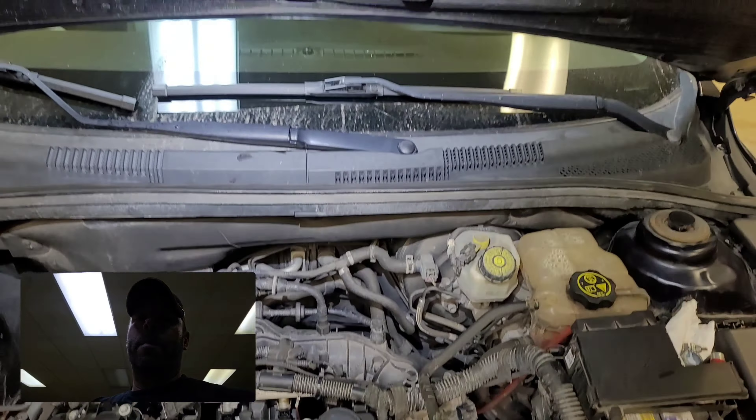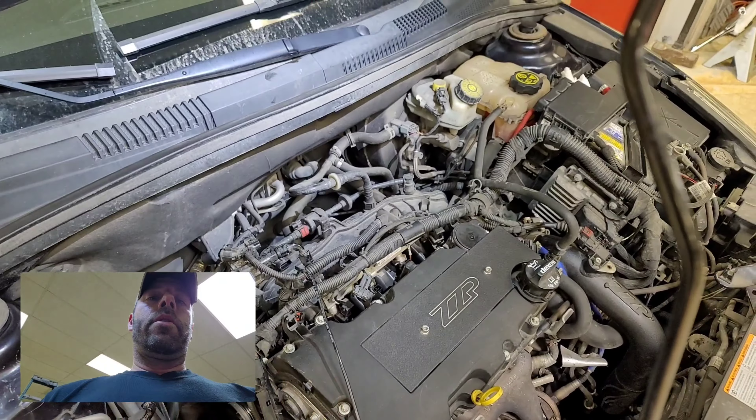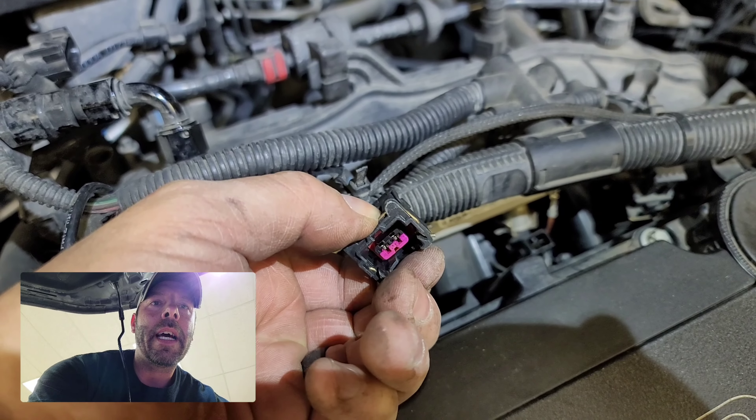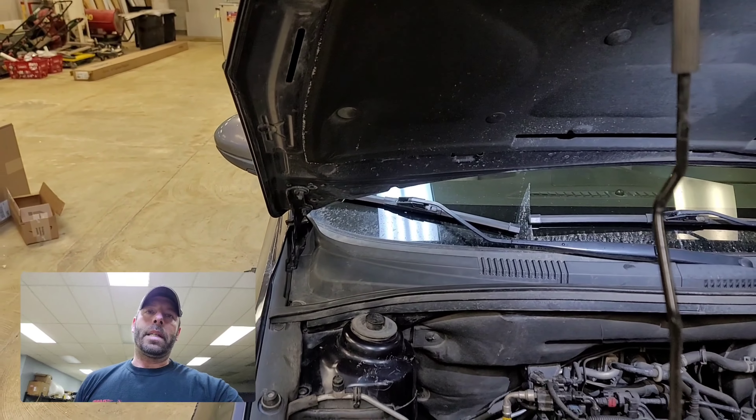What I got right here is the injector clip turned 80 or 90 degrees. So instead of the end of the injector clip facing that way, I have it facing backwards. You'll see a little small rod end sticking out right there, a little metal piece sticking out. You'll see my injector clip has two slots on both sides of it. You just slide that slot in there and rotate it 90 degrees and it pops into place on the other side, so it holds the injectors in place. Very easy, more secure. It's not really necessary because the fuel rail is being held down by two bolts which will hold the injectors in place, but for more security and sense of no worry, use the clips.